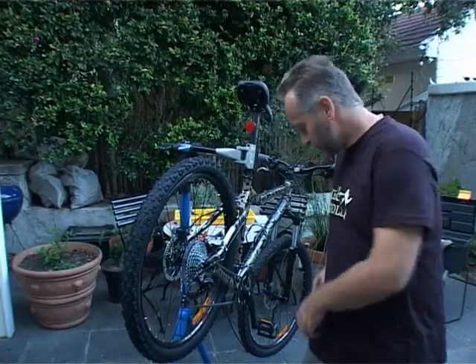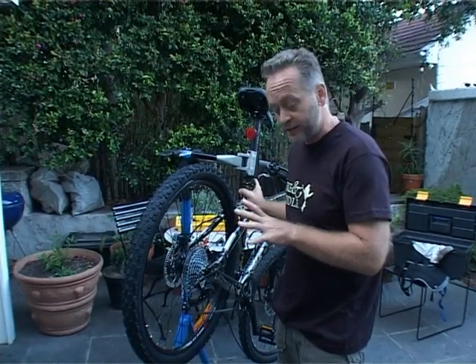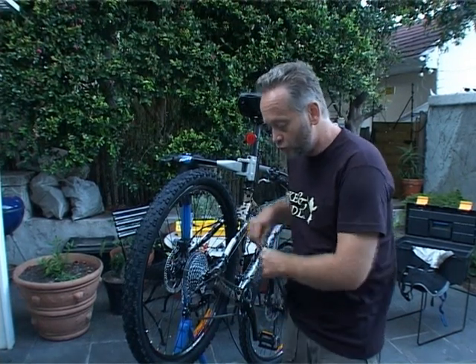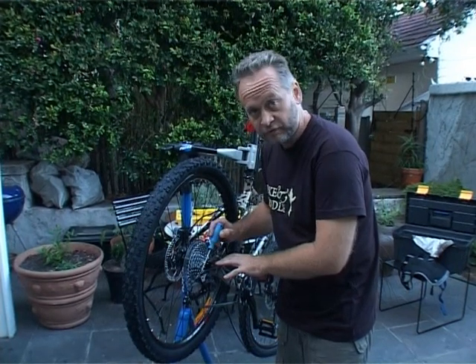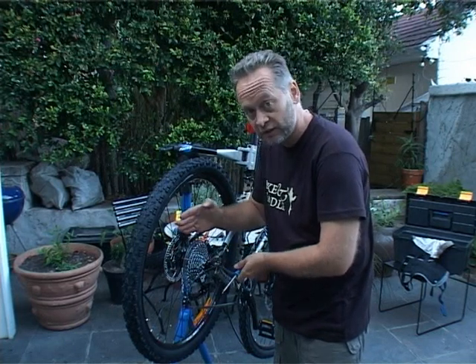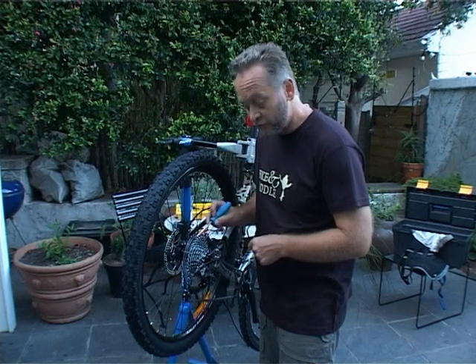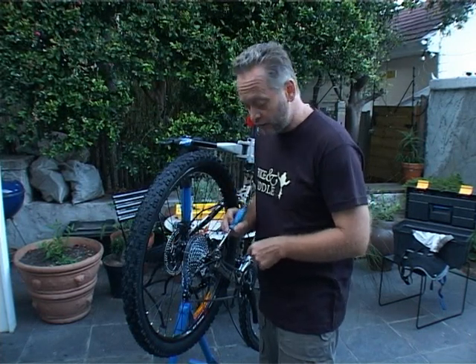After your wash, most important for a lot of reasons will be the gears. It is very frustrating for your clients to not understand how the gears work, and if they do understand but the gears aren't perfectly adjusted they can struggle. There are two things we're going to look at: first, the two limit screws at the back of the jockey — these adjust how far the jockey can go inside and how far it can go outside. Second, we'll be adjusting the shifting between the different gears at the back.